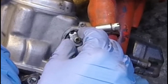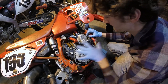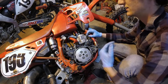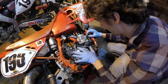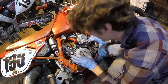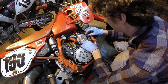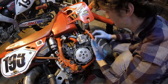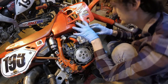We've gotten the case cover on, more or less. On my bike I can actually get this on and off while the motor is still installed in the frame, which is really great. On your bike you might not be able to — the weld here might be a little different in size. Now that we've got it back in position, I'm going to go ahead and try to line everything up. I'm about to hit the critical point of installing this. I can still move this up and down because those teeth haven't meshed with the guide yet. The only way to install this where it's timed correctly is to preload it in the opposite direction so that when you push down on it, it spins into the correct position.